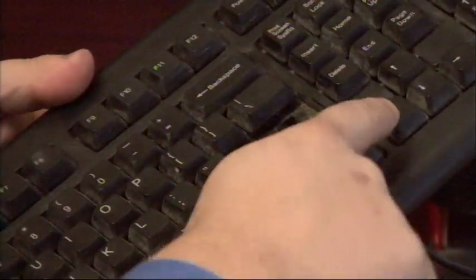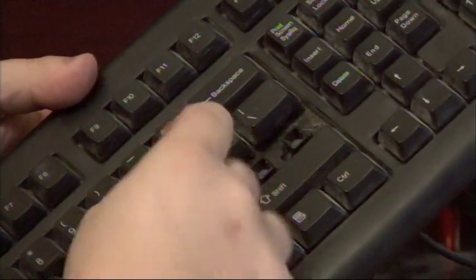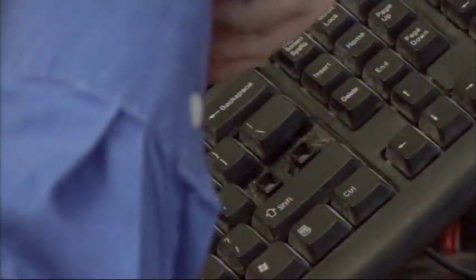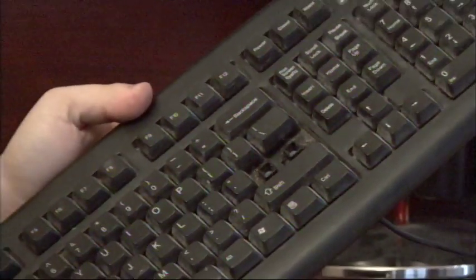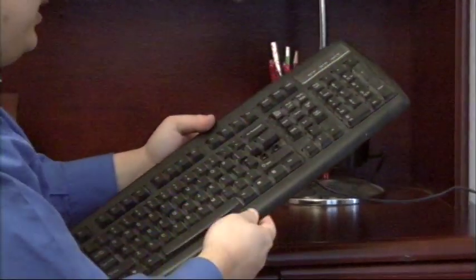What's important to note on these keys is that there's a little rubber panel inside of these two holes right here. On your key there's a little protruding area that sticks down into there. That rubber panel will compress and then push back up, and that's how your key pops back up after you push it. There's no real spring or anything — it's just a little rubberized bubble kind of thing that moves up and down to push your key back and forth.